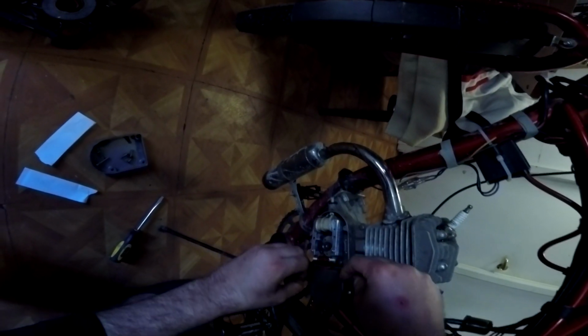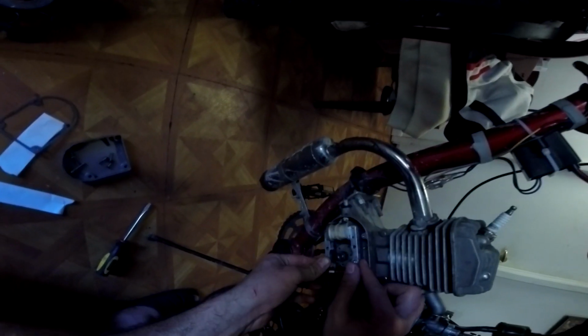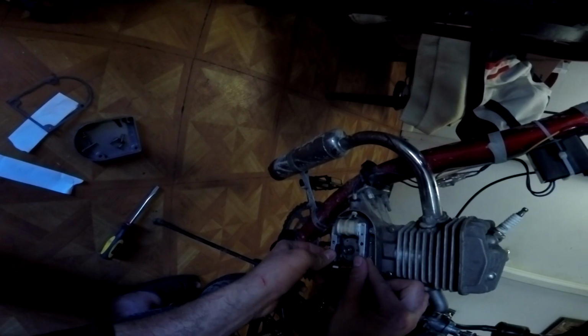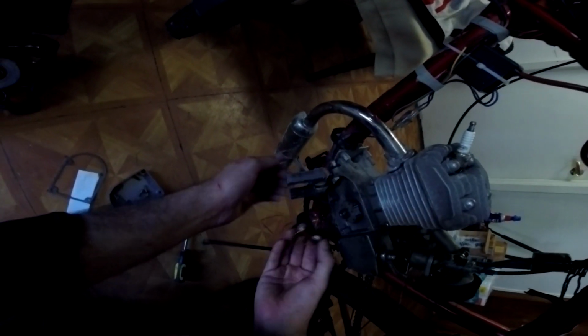If you guys are lost, don't worry, I'm going to bring you up to speed on what's going on in the video right now. So at the moment, you're seeing me install a 12-volt generator coil. It's an auxiliary coil that supplies its own voltage, which is designed to work with halogen bulbs. And for its intended purpose, I think it will work just fine, but we'll get into that in a moment.